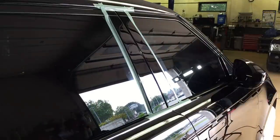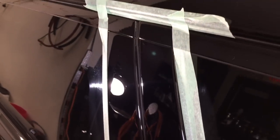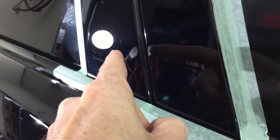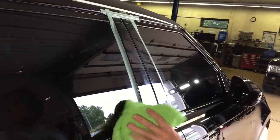I will be coating these, so that's going to really spike up the hardness from probably 2H, 1H, all the way up to 9 or 10H. So the first pass here, the first try, I really had very light pressure. And as you can see, there were one or two deeper scratches left behind. Everything else was removed with that finish pad, with that application pad. So I'm going to go over it one more time and see if I can get rid of those deeper ones with the same pad at just a little bit more pressure this time.